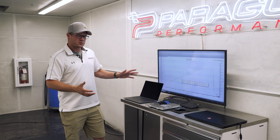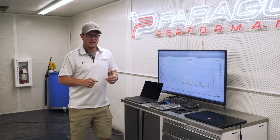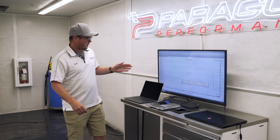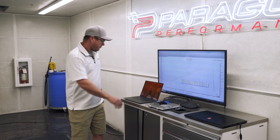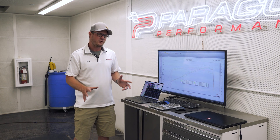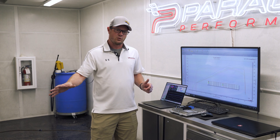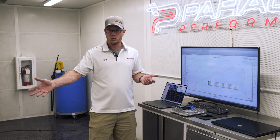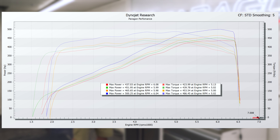Here's what we found. The car had 91 octane in it, and I think it's pretty low-grade 91 based on what I'm seeing. It's also June — it's hot and very humid here in the dyno room. We baselined the car with all the parts on it and the stock tune, and we ended up at 437 at the wheels and 423 torque. Now, with the ECM unlocked we can hook up to it even with the stock tune and see everything — how much timing is being pulled, how unhappy the ECM is with the fuel — which can make a big difference in the power swings on the dyno. So 437 was our baseline today.